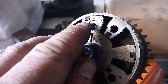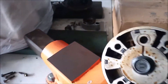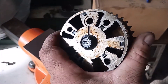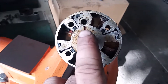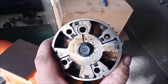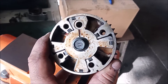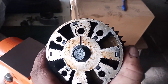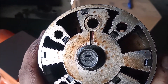This is the spring — you can just pull it right out and set it aside. With the spring removed from the pin, we can rotate this freely back and forth. This is the neutral position where the pin engages into the little locking cavity, and this is the position the gear returns to every time you stop the car. When you start the car, it builds up oil pressure, pushes the pin back out, and then the gear can rotate from its neutral position to its position of maximum advance.